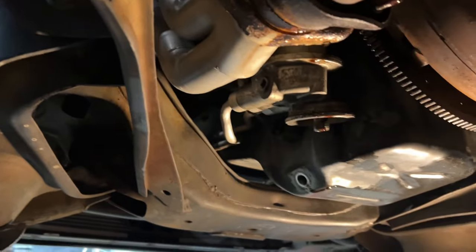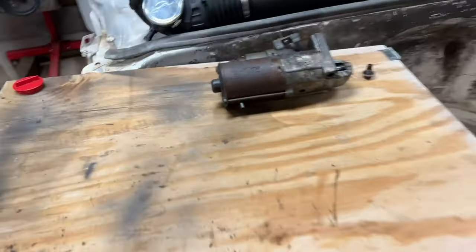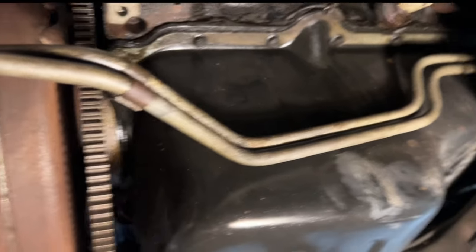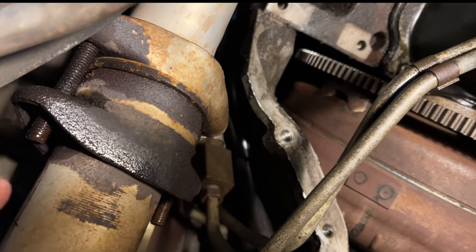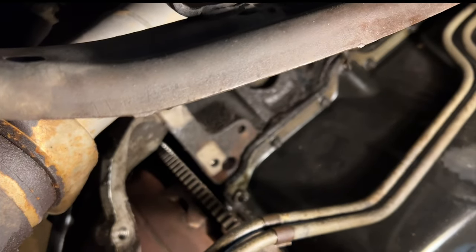Going underneath: we've drained the oil, dropped the oil cooler hose — just a couple of clamps, pulled it off, pretty simple. On the passenger side, the starter has been removed. You can see the thing is caked up. Wiping down some stuff underneath, the starter out gives us full exposure to what we need next. We've got to unhook the headers — been letting them soak a little bit. We'll pop these flanges off, then pop the motor mounts off, lift it up, clear our space, and start pulling the oil pan bolts off.